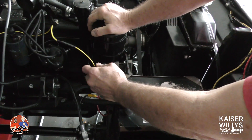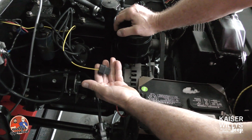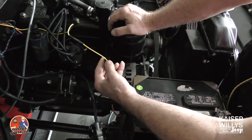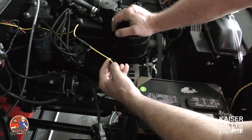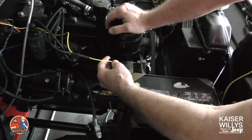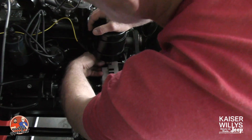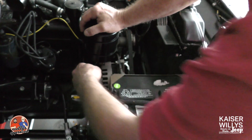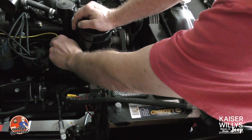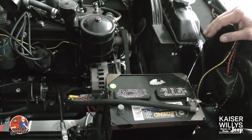This yellow wire here is the single wire — it's got a plug on it and it comes in line with a resistor, which you can see in that black area. You do have to put in an inline fuse, which we did before the gauge — it's under the dash. We bought a waterproof fuse holder and put that in line right before the gauge. This plug simply snaps onto the back of the alternator, so you just have that one wire leading back to the gauge and one wire leading up to the battery.